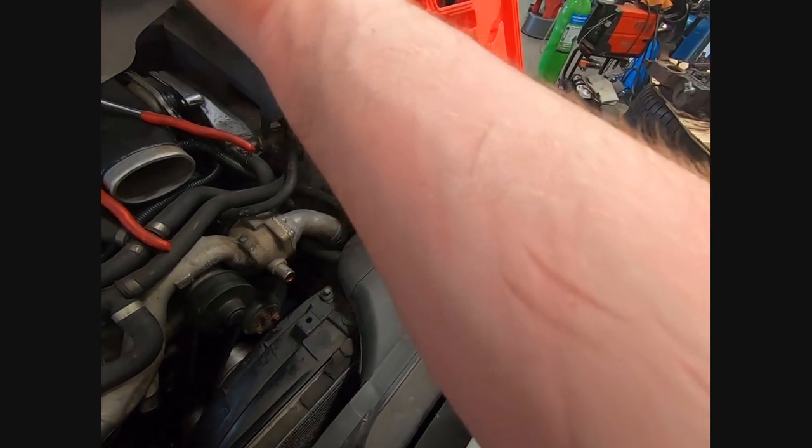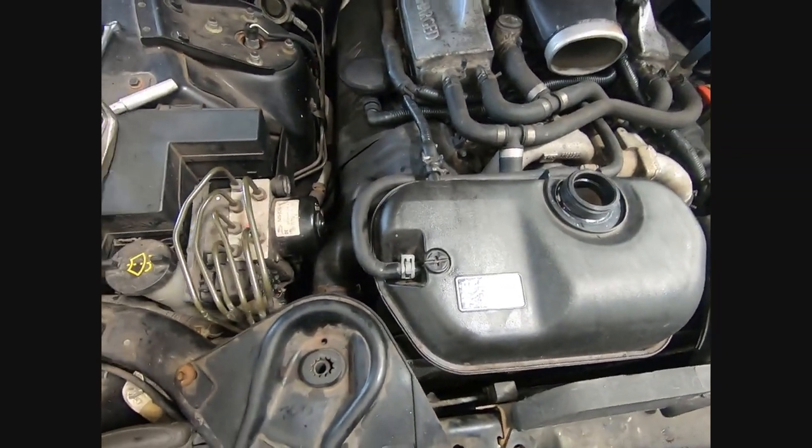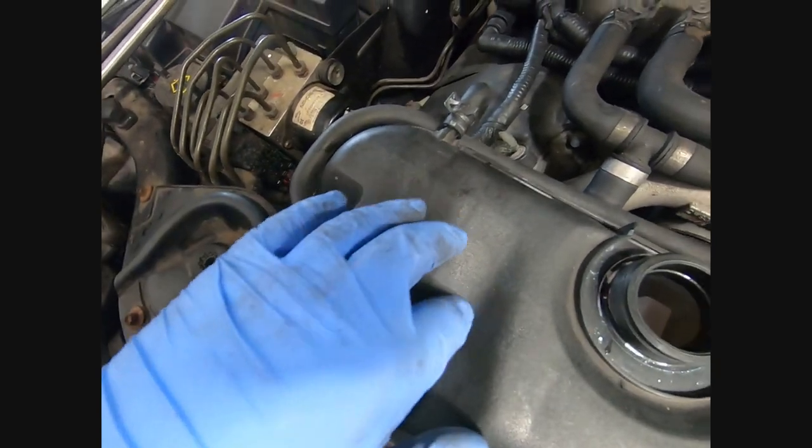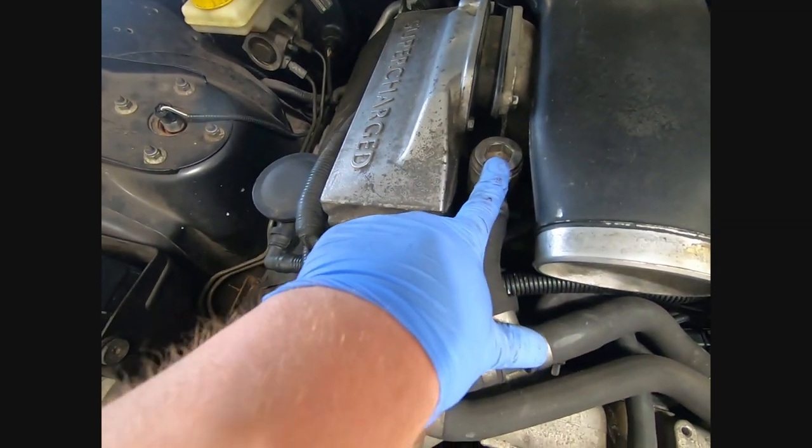After a fight, it is in - and some rather nasty marks on my arm from the fan cowling. I also noticed I need to put new anti-roll bar bushes in - now would have been the best time with all this access, but hindsight's great. Everything is back together. To bleed the reservoir, there's one bleed screw there, one on the supercharger, and a big one on the supercharger. Make sure you've got coolant in these - hopefully we won't get an airlock and overheating like last time.